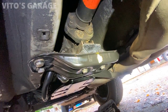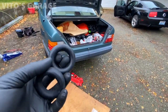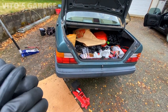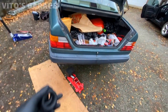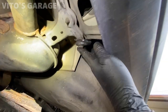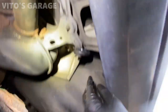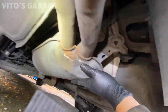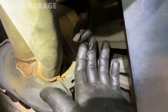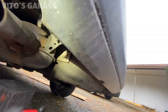I also cleaned up the area a bit so it looks really good. Now I have to replace a couple of muffler exhaust rubber mounts — it's actually pretty easy. I put two new rubber mounts on the muffler and also added a couple of zip ties just in case something decides to rip, so the exhaust is not going to fall off. It's just like a secondary safety measure.